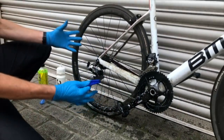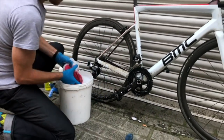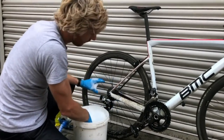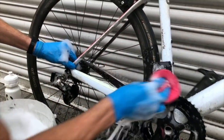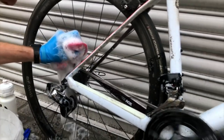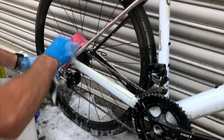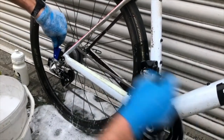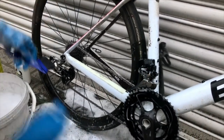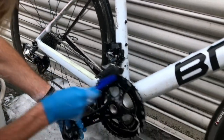Right now you can see it looks like a complete mess, and you think to yourself, oh my god, I've made it worse. In actual fact, whilst all that's doing its job, this is where good old faithful hot soapy water comes in. That's the importance of using the right type of degreaser — because with a water-soluble degreaser, this will now flush all that grime away. You'll see how quickly this drivetrain goes from really grubby to actually really quite clean, literally in a matter of minutes. You're not using the pressure of a hosepipe or anything, so in terms of bearing life, this is a really good way of cleaning things. You're not blasting it with a jet wash — you're literally using the power of the product just to keep things nice and clean.